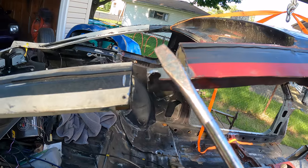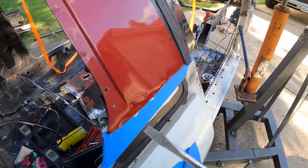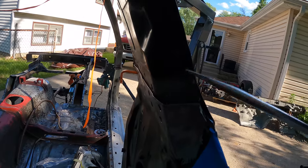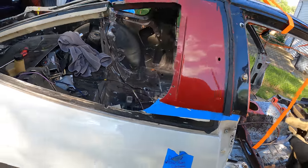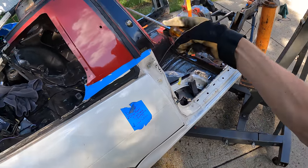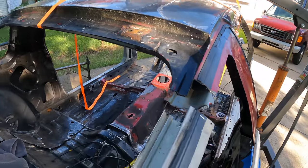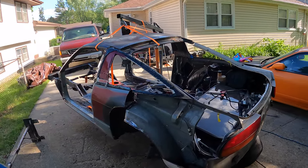The C-pillar would line up perfectly if it weren't for the one that needs to be trimmed, and the B-pillar needs trimming too. The back side is looking pretty good — it'll sit in there pretty nicely. I'm going to need to trim off some of this outside piece, which is actually the quarter panel. From the factory it's all one piece all the way up. I'll take this thing off and trim it real quick and then try it again. Look at this thing — it's starting to look like a car, it has a roof!